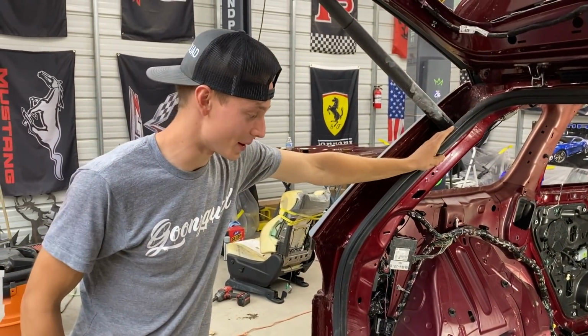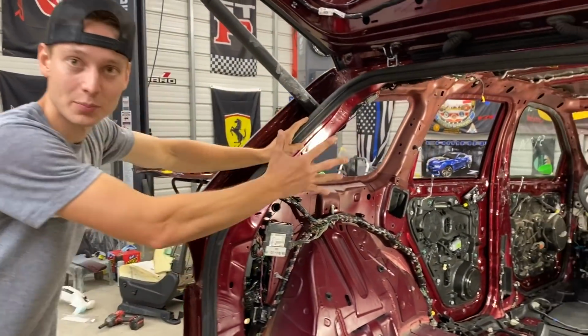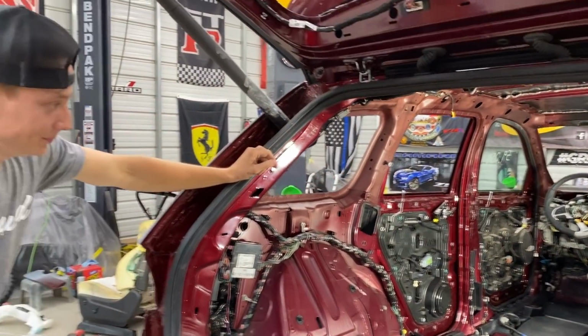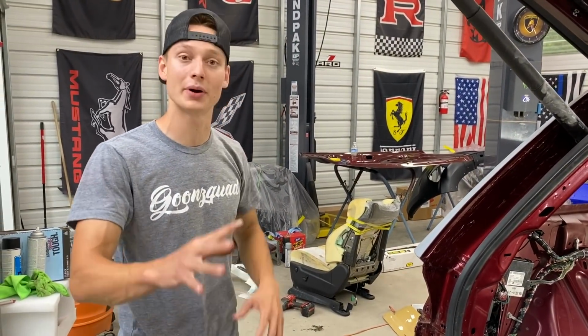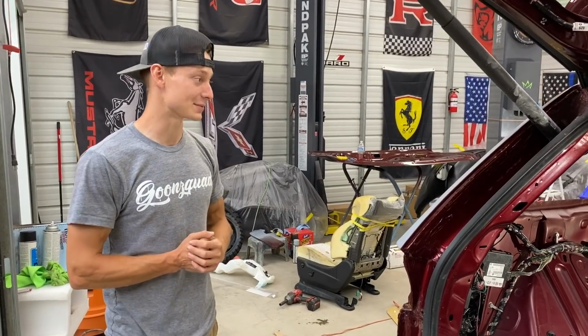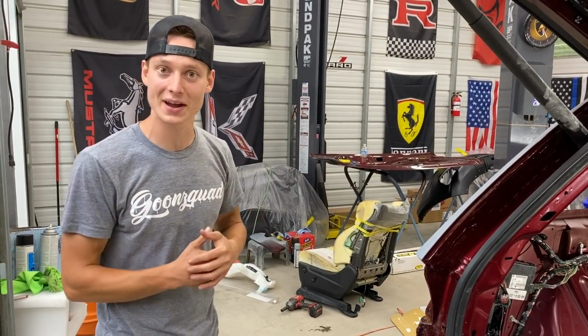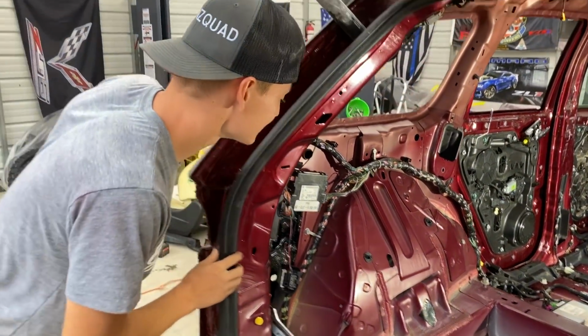Ready for the interior. Definitely that detailing did take the longest, and then what we had to do just to prep, prime, and paint. But it's starting to look good, and as you said, it's ready for the interior. But as we mentioned before, we're gonna hold off on that interior until we paint because we don't want any overspray getting on the Alcantara, that leather. Oh, for sure. Because it's just bound to happen. It can slip through any crack or crevice. There's so much. Just look at the inside. Look how many holes there are. There's like millions of them everywhere.